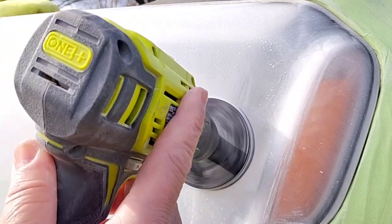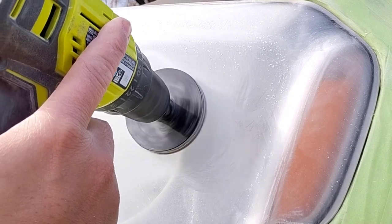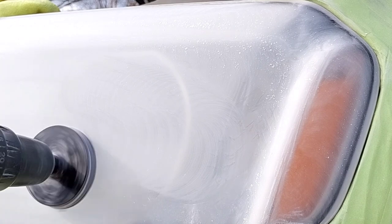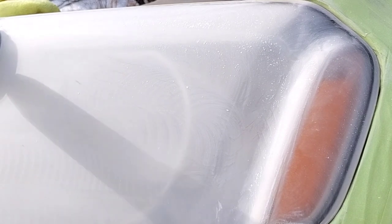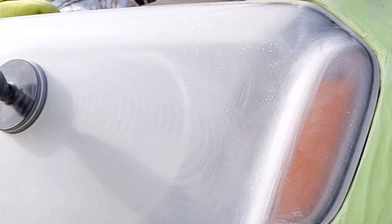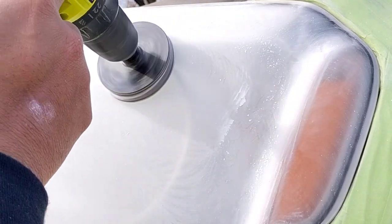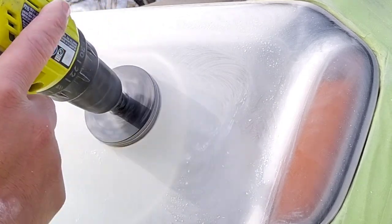Now, just imagine, with that poor surface, think of something on a grander scale, like you said, like a sponge. I'm polishing out that sponge. That's why it's called a sponge. It has all these pores in it and it soaks stuff up. So that's what the surface looks like. It's soaking up whatever you're putting on there, and what they're putting on there has very minimum UV protection, if any. It's leaving a pretty much naked and exposed polycarbonate headlight surface.